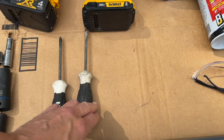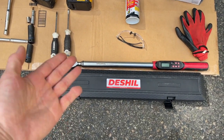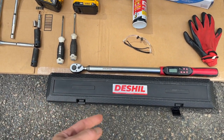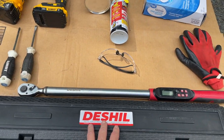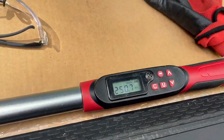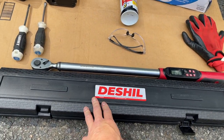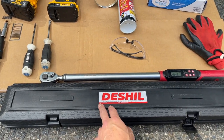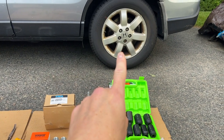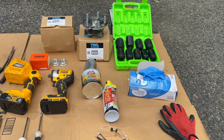Basic flat-head screwdriver. And as I do more and more stuff — I'm not an expert — it seems like torquing everything to specifications is the best thing to do. I got this torque wrench from Amazon, goes up to 250 foot-pounds of torque. Very easy to use, all digital. Just turn it on, set it to whatever you want, it'll beep and light up. About 60–70 bucks. Those are the things you're going to need to do this 2007–2011 rear wheel bearing replacement on this particular vehicle.